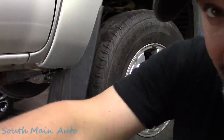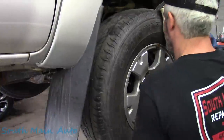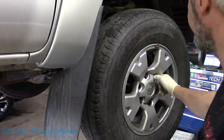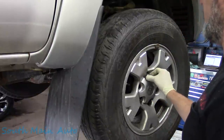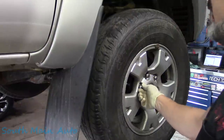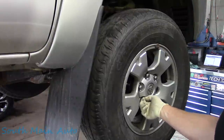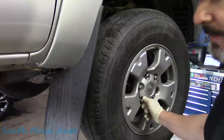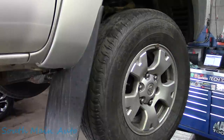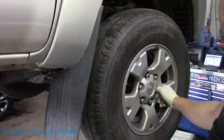My guy Josh put the brakes on it last week, so we're good with that. So we should be good to go on our test drive. We need to pick that lug nut up off the floor. I'm gonna check all the tire pressures. We're gonna get this torque down to factory specs, go through and torque all the other bolts to factory specs, of course. And then we're gonna take it for a shakedown to see if the mouse or rodent got somewhere where we couldn't see, but I'm pretty sure we got all the damage. Looked it over pretty good underneath, didn't see anything else under there. Hopefully, this fixes our engine light. And that was it, because you remember it had the code for the cam sensor, I believe it was. A really long crank time.